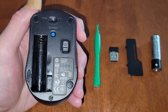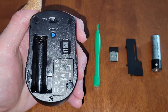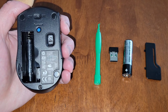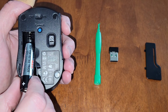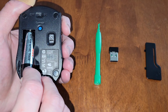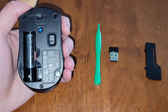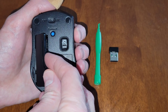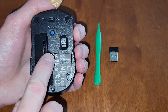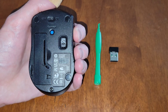If your battery was installed the correct direction, another thing you can try is using a brand new battery. I'm going to reinstall this battery since it's okay — just make sure you install it the correct direction and all the way into place. Now I'm going to reinstall the battery cover, lining up one side first and then gently pressing down on the other side until it snaps back into place.